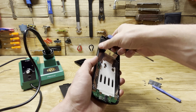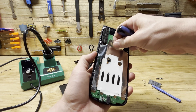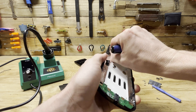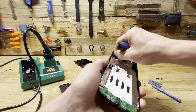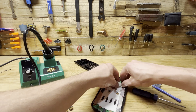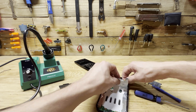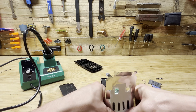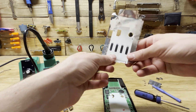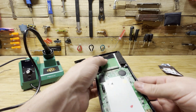We're going to take this shielding off — it's got a couple of Phillips screws holding it in. We can try to get it off; it might be harder since it has foam pieces kind of holding it on. After peeling those up on each side, this should be able to come off. It's usually glued on a little bit at the bottom. That exposes the ribbon cable here.